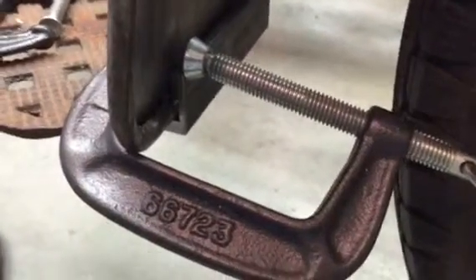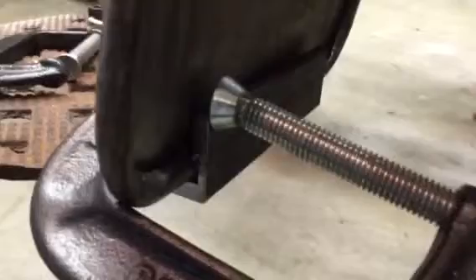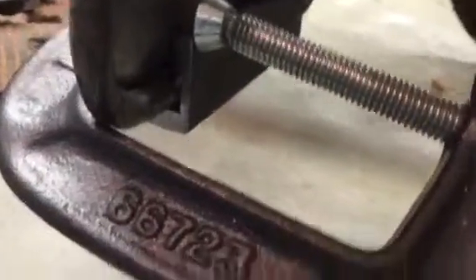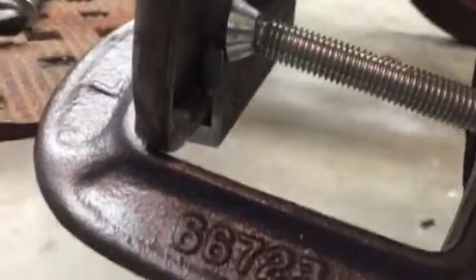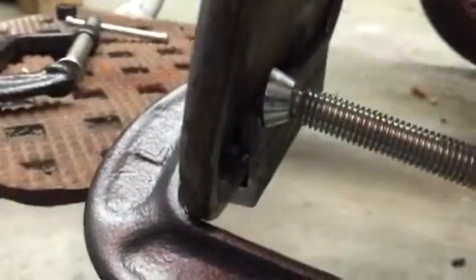Okay Uncle Chris, this is the little bracket I made to go from the step plate here to hold on to the fender. I kind of have no idea what it's really supposed to look like, so I took a piece of angle iron and milled it out so it accepted the bead back here, and screwed it in there just so I could get the fender all on.